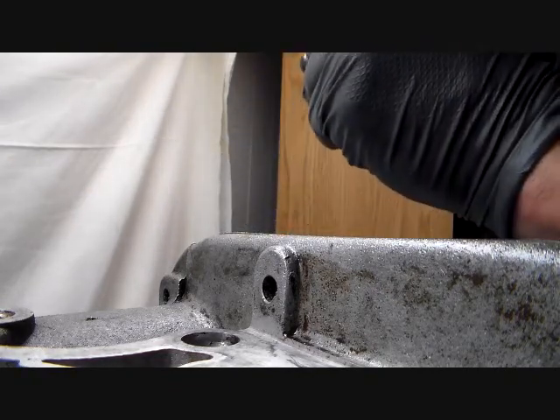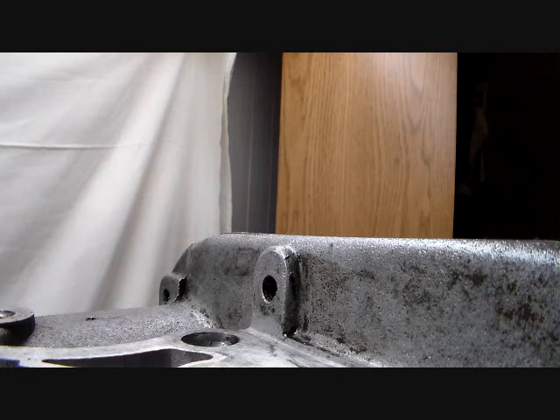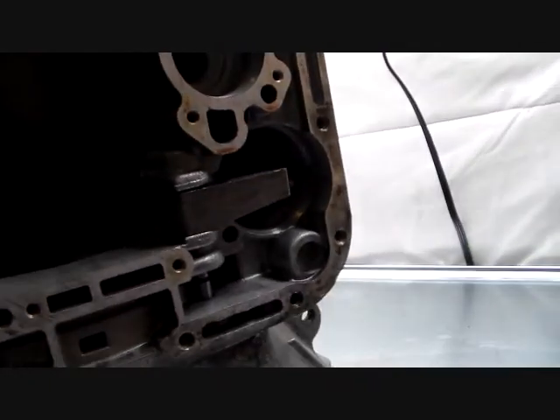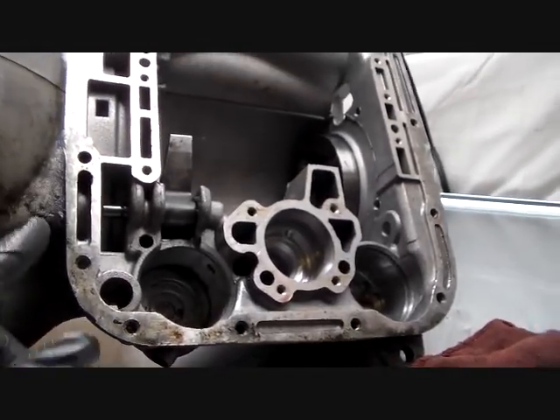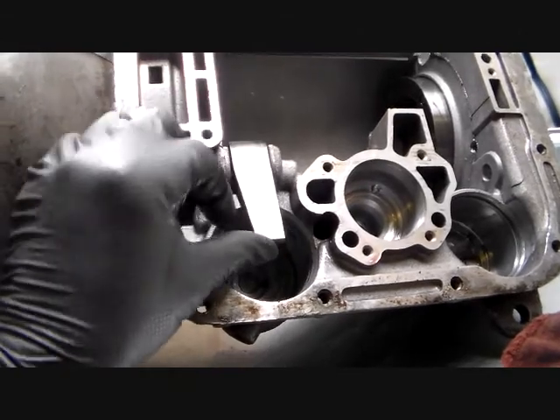What I'm doing now is just working on sub-assemblies — getting them laid out on the table. I'm going to bag that up. The other pin needs to come out too. This is the band apply lever — the kickdown band lever. We got that one out from the back, so I've got it for safekeeping until I'm ready to clean it and put a new O-ring on. Then we have the front kickdown band apply lever.